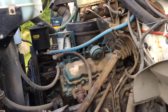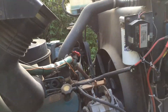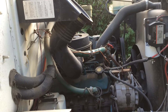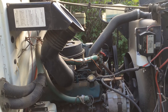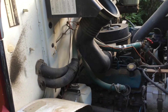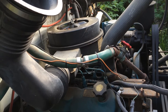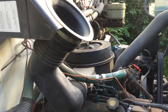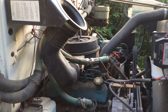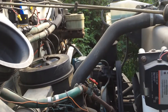If anyone has any idea how I can squeeze a little more performance out of this thing, please let me know. I haven't replaced any of the fuel filters yet — I'm going to do that. Do I need to replace the injectors? As far as I know, this bus sat for two to three years before I bought it, and someone told me that these old Ford non-turbo 7.3 injectors will go out when they're not being used. I might also need a glow plug or glow plug controller — otherwise it should start up pretty quick in the winter. Right now it's a nightmare to get it started, with propane space heaters pointed at the block and cranking repeatedly. Please help me fix this wheelchair motorhome for my dad.